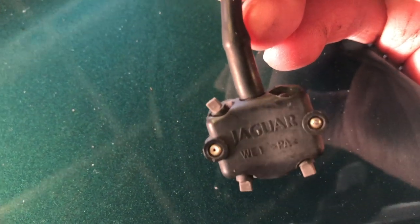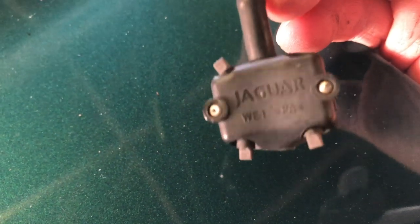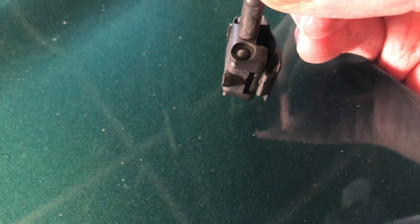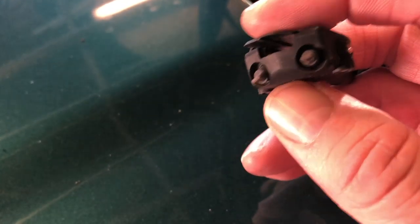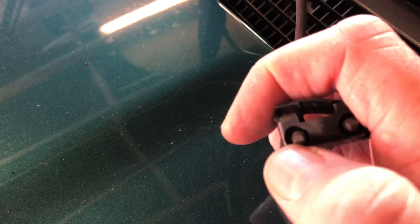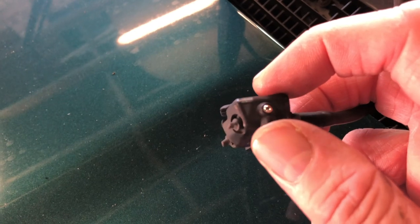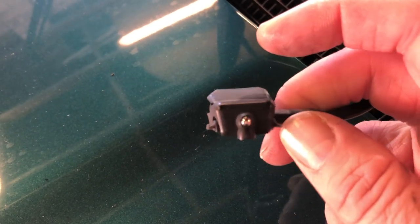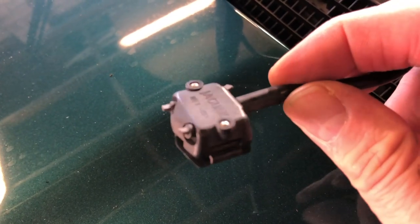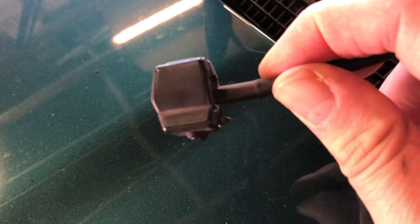And that is one of our wiper jets off. Upside down you can see we have two what appear to be ball jets, but the one in the back is blind. You've got three rubber nozzles — or duck bills — and they are soft, which should prevent your washer jets from blocking and means they're less likely to freeze, because lumpy things can force their way out.